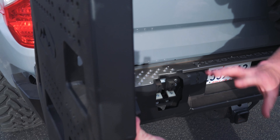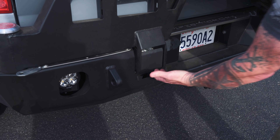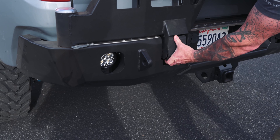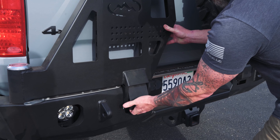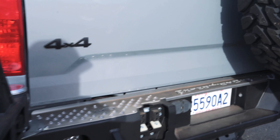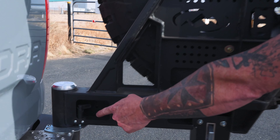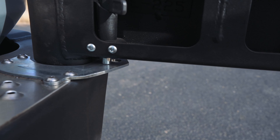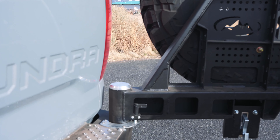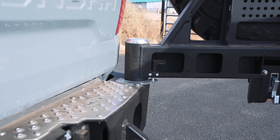A good rule of thumb is to spray some dry lube up in the spring mechanism to keep dust from building up. Use an open hand with your fingers under here — do not put your thumb in here for leverage, you'll do that once because as you open it and crush your thumb it's no fun. Just use your hand and open like this and it'll fall open. Babysit the thing open and let your pin drop into place — especially with the weight of the tire, bring it open and watch where your pin rides on the plate and it'll drop down into the hole. If you let it swing open and slam into place you could damage the pin, and if it flew open your tire can swing around and hit the side of your truck.